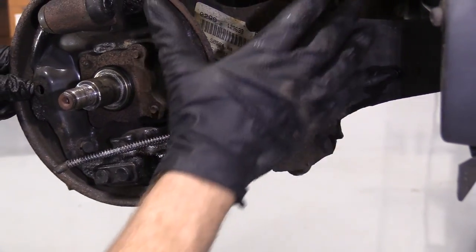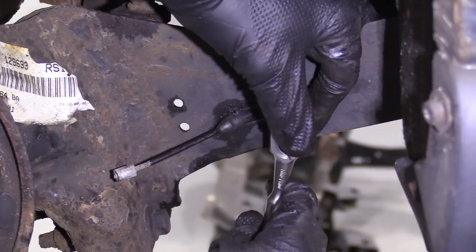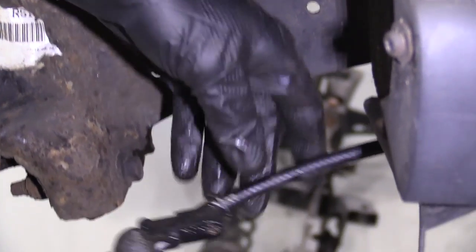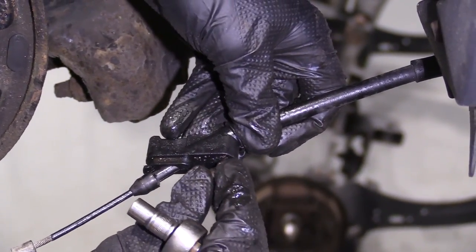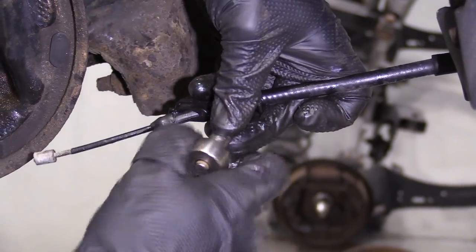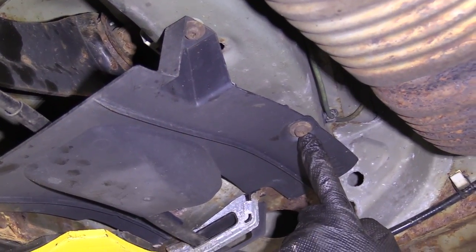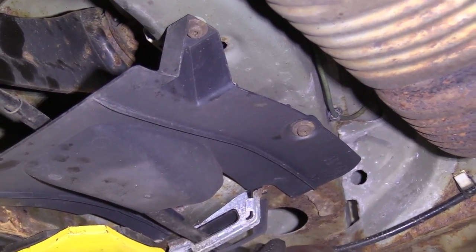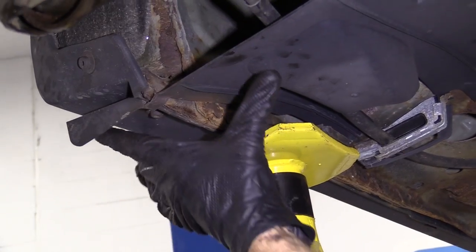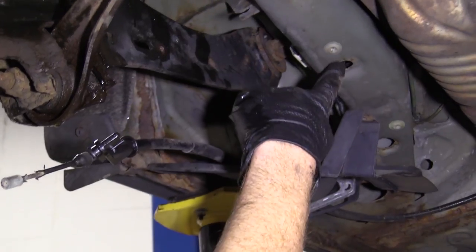This is going to go with the rest of the subframe, and we're going to get the e-brake cable out of this spot. This bolt right here is a 7 millimeter — I'm going to use a quarter inch ratchet and socket. This bolt goes through this arm and then screws into this plastic piece. Small bolts like this are easy to lose, so I'm just going to start it back in there. Now we're going to do the same thing to the other side of the vehicle — we'll take out these Torx bolts. They're T30s, like a little star headed tool. There are three of them, and we'll get this plastic shield out of the way.